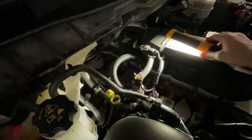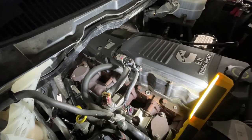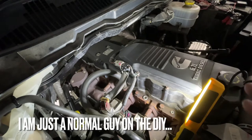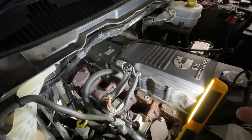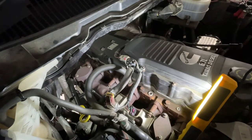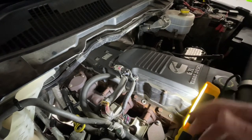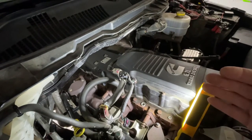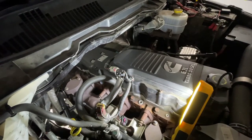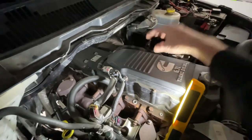Just a warning — I am not a professional mechanic or electrician. I'm just a normal guy doing DIY, trying to learn as I go and make videos showing what I've learned. So during normal engine combustion, your pistons go up and down creating combustion, but sometimes oil can get past the pistons and go up into your crankcase — especially if pistons are cold or the truck hasn't been running long enough for them to expand.